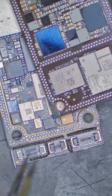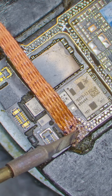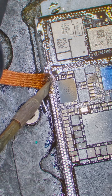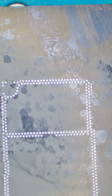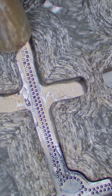Next, we need to solder the two sandwich boards back together to see if the phone turns on. First, we clean all the old solder off the bottom layer, then clean the solder off the top layer. Then we put a stencil over the bottom layer, which has tiny holes for each solder joint. We rub solder paste into them and compact with a dry wipe.